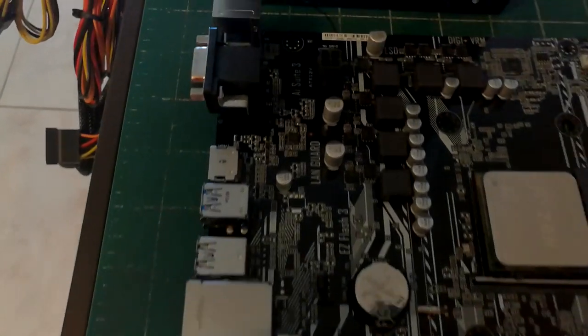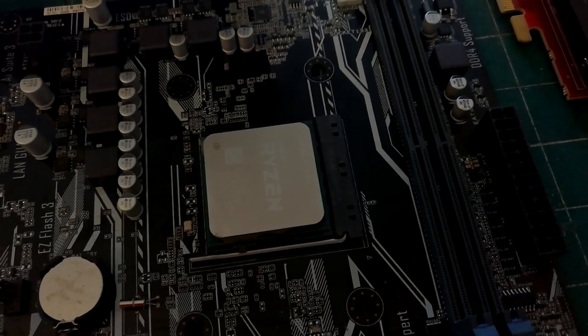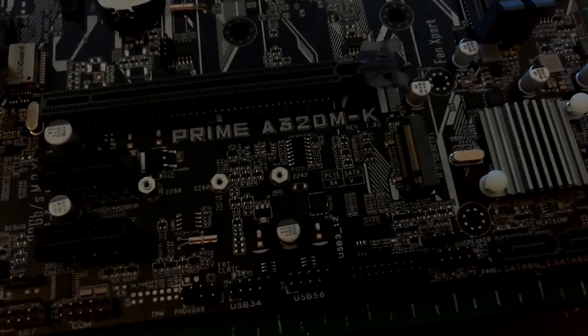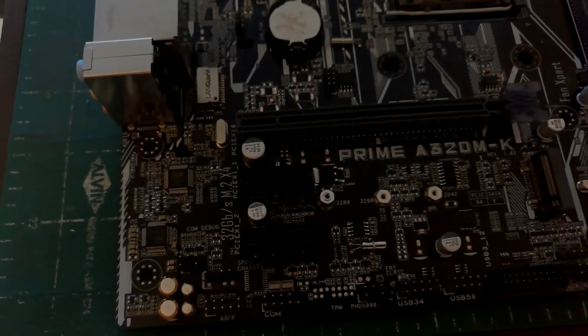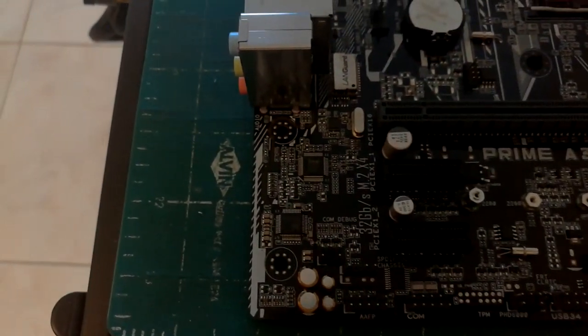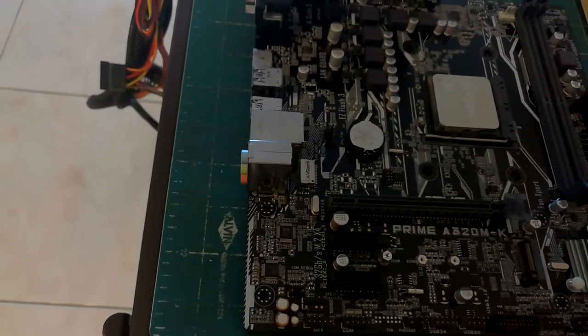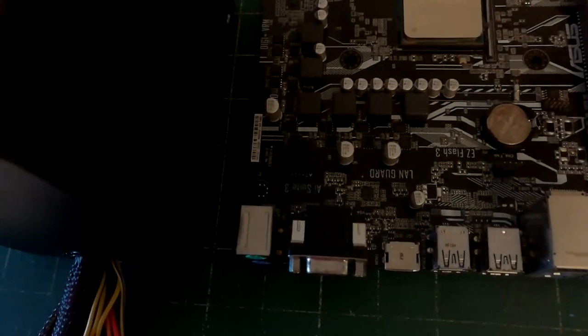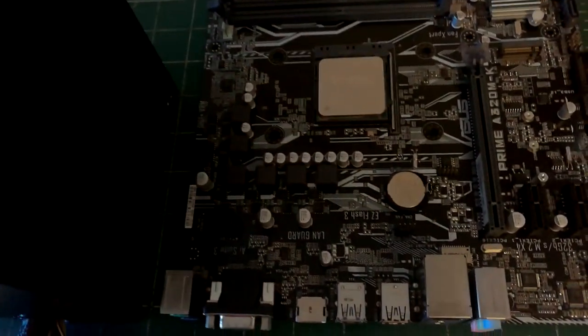This motherboard is great, as you see: low VRM, only one 4-pin CPU connector. It has your 24-pin connector, four SATAs, one M.2. Now keep in mind, if you use the M.2, SATA 0 will be disabled, so you're going to have the M.2 drive, SATA 2, SATA 3, SATA 4 if you go SSDs. But if you use SATA hard drives over here, all four ports are operational. Okay, great motherboard. I cannot go wrong with it. Non-overclockable, it works for me. It supports what I do.